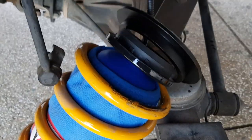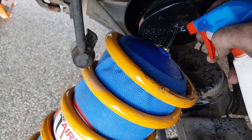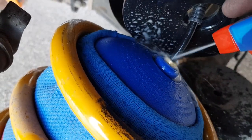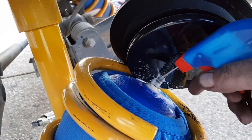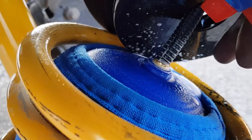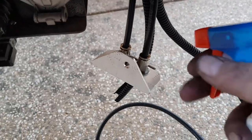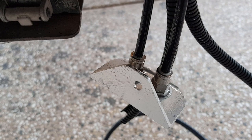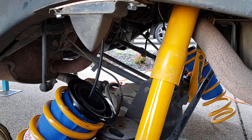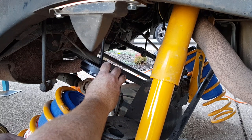Moment of truth. I've just got a spray bottle here with some soapy water in it. You can actually see that's not bubbling or anything, so obviously that fitting is really good. We're just going to check this fitting now — no bubbling there. So we're at the valves now — look at that, fantastic. I've just gone around and tested all the fittings with some soapy water to make sure there are no leaks. Luckily we didn't have any, so that's been fantastic.